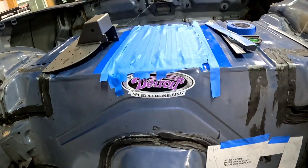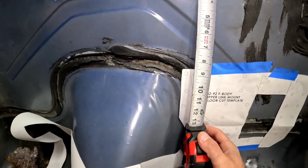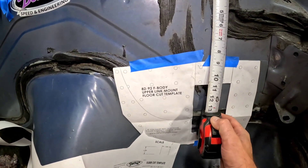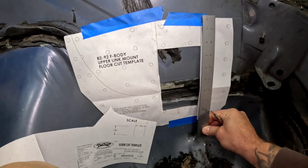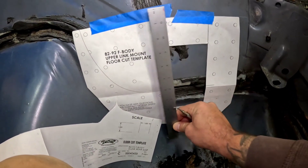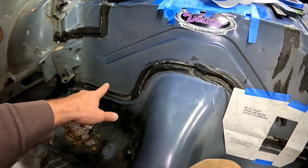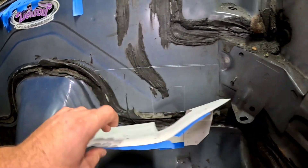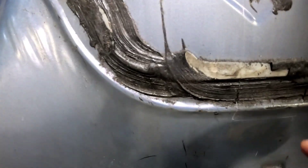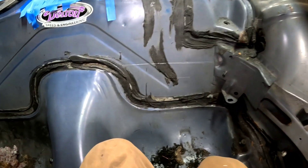I just took my time, just like doing the closing plate. I used a machinist ruler and a regular measuring tape. I took a whole bunch of measurement spots because you want this to be right. Used the scribe, marked my line, and found that using a machinist ruler to push against the paper to scribe against worked out pretty well. I'm going to just do this side today and then do that side another day. I initially screwed up here, so that's why I said just take your time measuring. The theme with all this Detroit Speed stuff seems to be: tight cuts make your life easier.